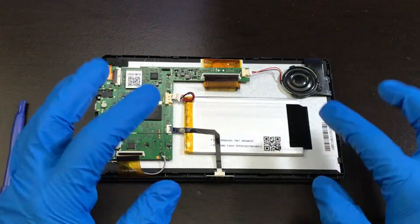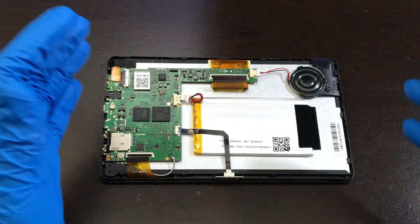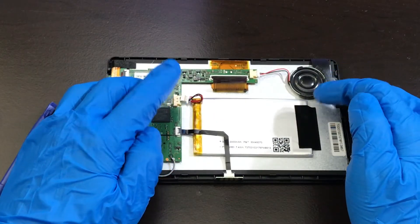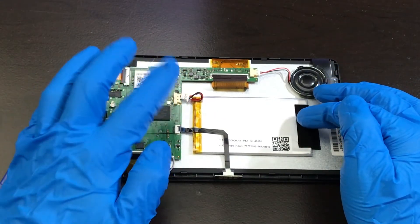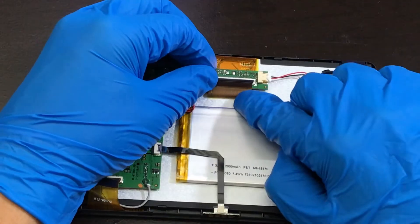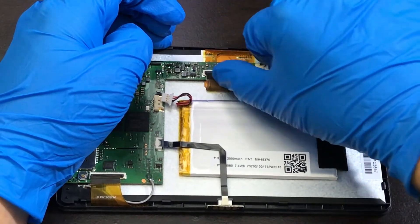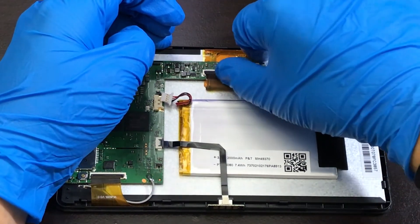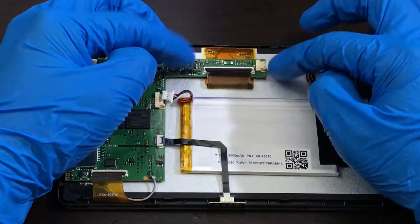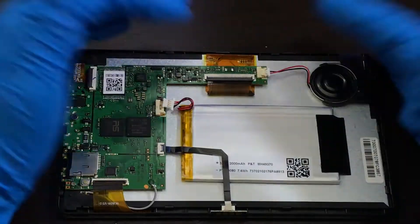You now have both connections and the battery disconnected. Have it disconnected for around 1 to 10 minutes, then connect everything back together. After the 10 minutes, connect the screen and the other connection first, then connect the battery connection last — you should always connect the battery connection last. Once inserted, there's a little tab you can grab with your nails and push in. Just make sure you don't push it too hard. Once everything is connected evenly, close the tab down and it should sit just like that.